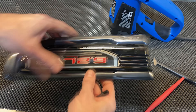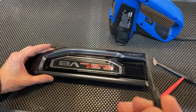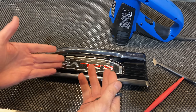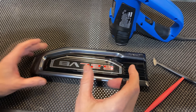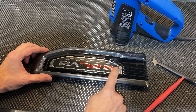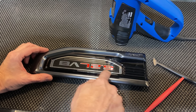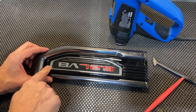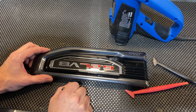We have the badge here. We're going to heat this up with a heat gun, peel it back a little bit with this small flat screwdriver. This could get damaged in the process — that's okay, I'm not planning to go back to this one, but just be warned you could end up damaging this. You could just take the new badge and stick it over top of this one, but it's not going to make proper contact with the adhesive. So I'm going to peel it off, and be careful you don't also scratch the little black areas surrounding this. I want to keep it nice and glossy, so I'm going to be very careful to get the edge started and then I'll use a plastic tool from there.